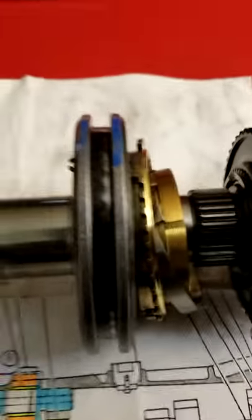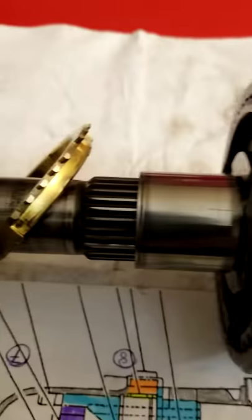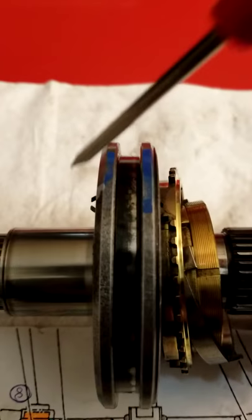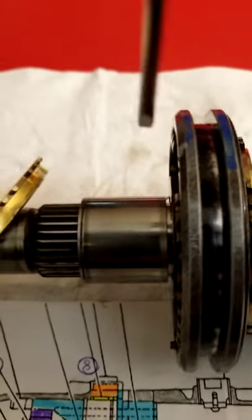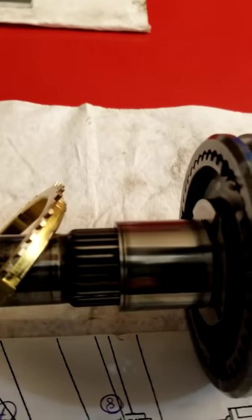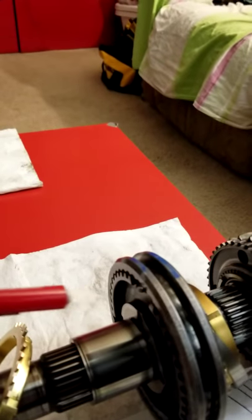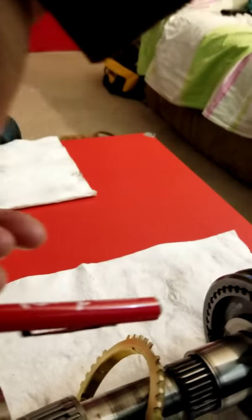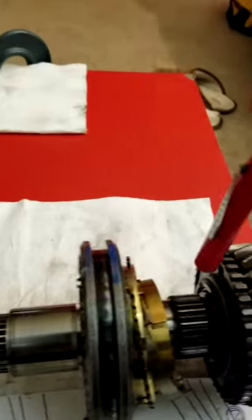Pay attention to the direction of your selector. You see this little shoulder? And here you have a chamfer. If you were careful before and respected the order when marking, going this way — because you were making pictures facing from the front — your marks are going to face you, and everything is going to be in the correct order.